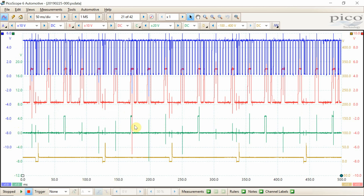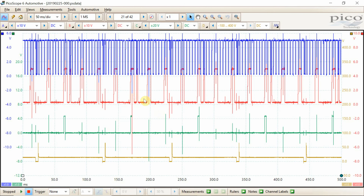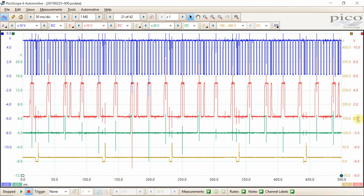As you see here we have this noise or interference. The more I'm testing cars, I'm realizing this is kind of a common thing — it's not bad. The scope is just showing us exactly what is on the signal; the scope isn't lying. I wonder internally what type of filtering the PCM for a vehicle actually has to filter out noise, because I see these areas and think, wow, that's noisy — and what's really going on? I'm trying to learn and figure that out.